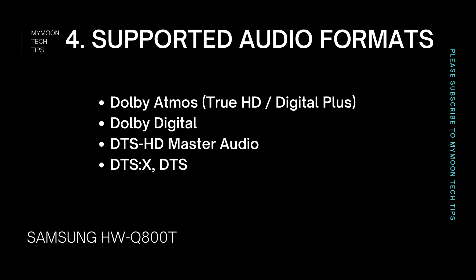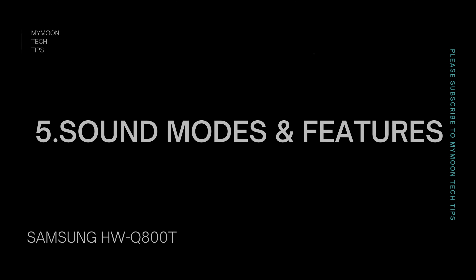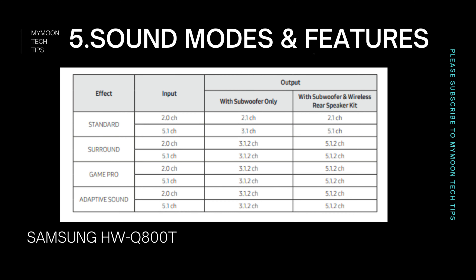When it comes to audio format support, this soundbar supports Dolby Atmos in TrueHD format as well as Dolby Digital Plus. This means it can support Dolby Atmos via both ARC and eARC. Via eARC, this soundbar gets the full Dolby Atmos potential. Via ARC it supports limited Dolby Atmos features — in TrueHD you get a lot of immersive sound effects, but in Dolby Digital Plus you get minimal immersive sound effects. If you have a dedicated eARC port, investing in a Dolby Atmos soundbar is going to be the best buy.